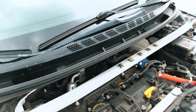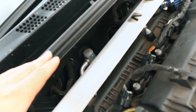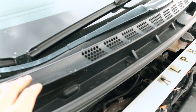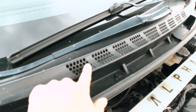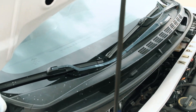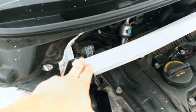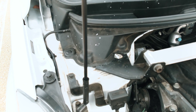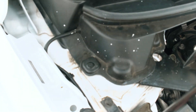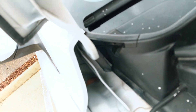Let's get a bit more space in here. It'll be even easier if you don't have a strut bar like this. To get more space, you can see we have part of the windshield and upper hood venting connecting to the seals for the windshield here, so we're going to go ahead and remove that piece. This is actually one of the first mods I did on my car — the strut bar — which I'll talk about in another video. But this could be a lead-in to it because we're going to be removing this, and it's super easy.